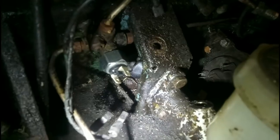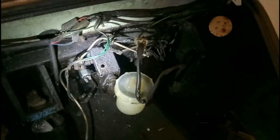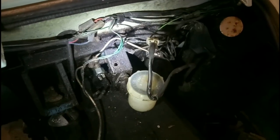The thing to remember with any car project is there are days when it's just no fun at all, and this is one of those. I've had my battles with the brake shoes, can't get them on. Thought I'd have a go with the master cylinder down here, and this isn't fun either. You've got just these two bolts that hold the master cylinder in place, but they attach to this bracket. If whoever made this bracket had used captive nuts, this job would be a piece of cake — but they're not captive, they're free to move. The thickness of the plate means it's nigh on impossible to get a spanner on, so I'm having to use a ratchet. But there's not enough room for a ratchet because the horn's in the way — so now the horn's got to come off. These nuts are very tight and they're just soaking in penetrating oil. It all just ends up making you wonder why on earth you bother when you could be sitting in front of the fire with a cup of tea watching the snooker.